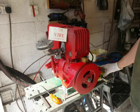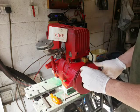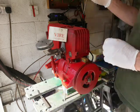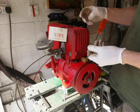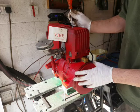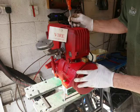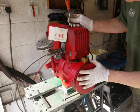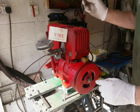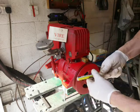I've just refurbished this economy engine — I hope you like red, it's unusual. There's a little notch here. I'm a bit of a perfectionist and I don't trust that notch, so if you get the spark plug out and put a long clean screwdriver through the spark plug hole, you can actually feel the screwdriver going up and down and rock it until you find the exact top dead centre.